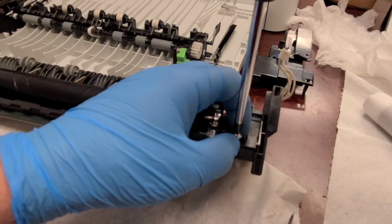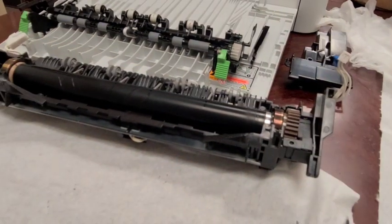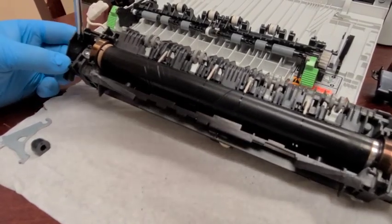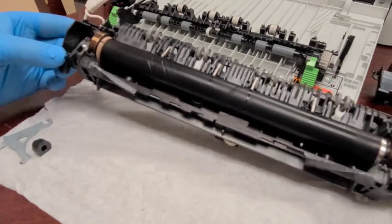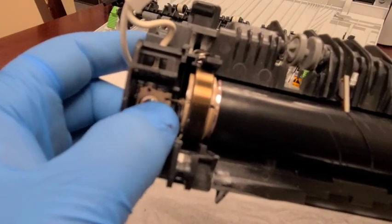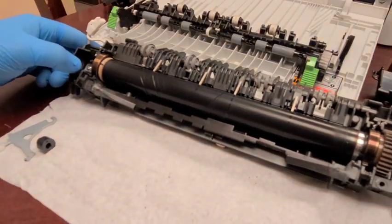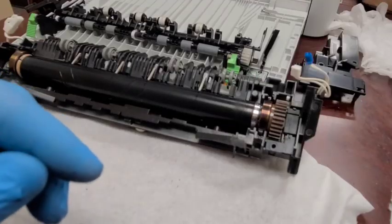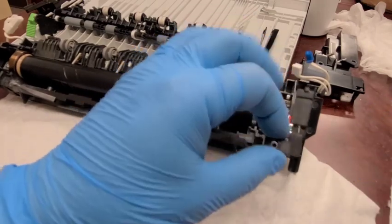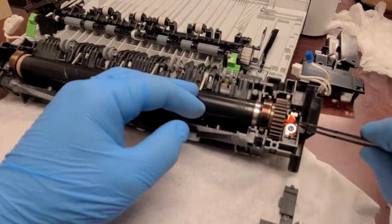I'm leaving the other parts in place so I don't forget where things go when reassembling. Let's take the screw on the right. On the left, there's an electrical electrode connected — probably from the heating element — so be very careful. Once the screw is off, this little cover panel comes right off, exposing another screw where the heating element is connected.